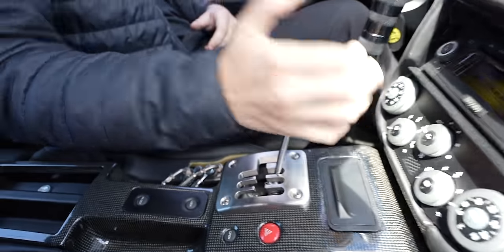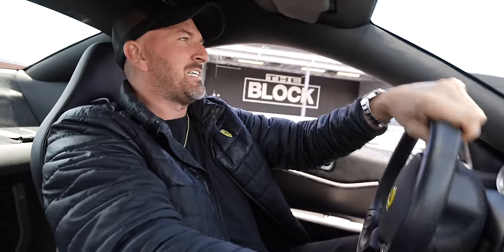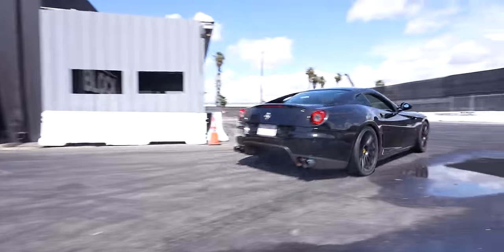First of all, we had to take apart the manual system to copy it, but unfortunately, we can't get first gear to align properly, so right now I have to beat it to get it in first gear. Again, it's running, and we're all excited, and well, watch what happens when I dump the clutch. It kills all power. Something wrong with the ECU. The handbrake works, once I get on the throttle, it cuts all power. So, what do you do with this now? It was pretty much a completely useless 599. I can drive it out somewhat normal, but what's the point?